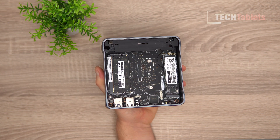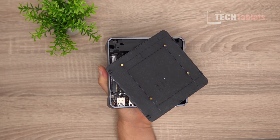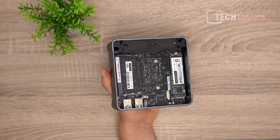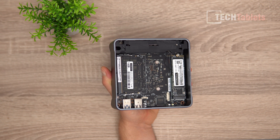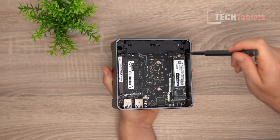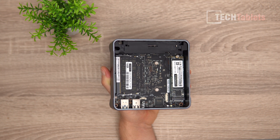The lid wasn't difficult to remove, though I did need a pry tool to pop it out. On the reverse of the lid there are four mounting points for a SATA 3 2.5-inch drive — the cable to connect it would go right here, but it's not included in the box. The SSD is a 22x80 M.2 size and can be replaced. There is a second M.2 slot on the reverse of the motherboard, but to access it you'd need to pull the motherboard out entirely — a bit of a shame, but you can install a SATA 3 22x80 drive there.